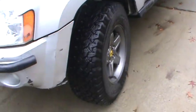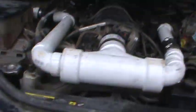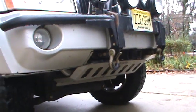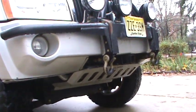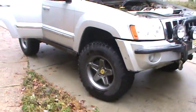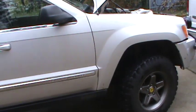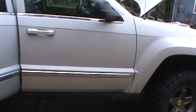It sinks to the bottom and I just crawl out. I've got lockers front and rear. Terrific platform, a lot of armor plating on it. Before anybody says the pipes aren't armored — there's a complete armor system going on here: steel plate on the bottom, all welded in around the pipes on both sides. They will be boxed, double layered. You'll literally be able to jack up the entire Jeep just on the armor, protecting the plastic PVC.